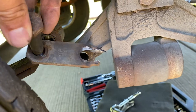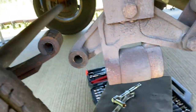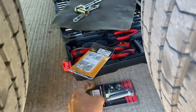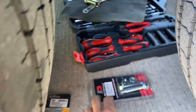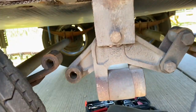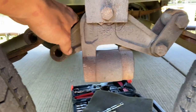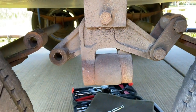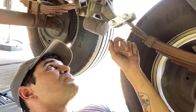So what I've done is I just went ahead and took out the old shackles — pretty easy thing to do, just unbolted them. Went down to the local RV store and they had replacement shackles and bolts, 23 bucks. And now I got this side jacked up so that it relieved the pressure, and now this is back to even and I'll be able to put the shackle in here. So now I got this shackle replaced and tightened these bolts down pretty good.